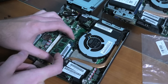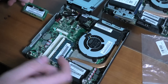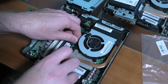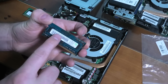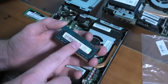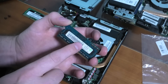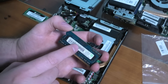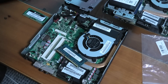This one should be the two gigabyte — Corsair, probably. It has six gigabytes total. This one looks very much like the original Lenovo because it has a Lenovo sticker on it — four gigabytes. You have to be careful when you go shopping for this RAM: it has to be PC3L RAM. The L is important. I'm not sure if you can use two non-L sticks, but if there's one L RAM in here, you definitely need another L RAM for this to work. So this one is good — four gigabytes.